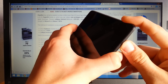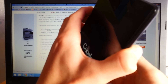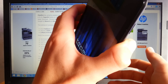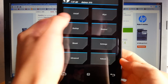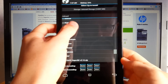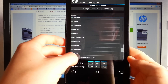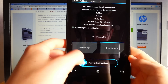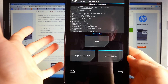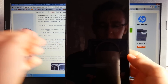Press and hold volume up only when the Google logo appears, and our TWRP recovery should still be there — which it is. Now select the update SuperSU version 2.x zip, swipe to confirm flash. You can also wipe cache if you like but you don't have to. Then reboot system.